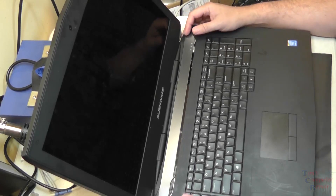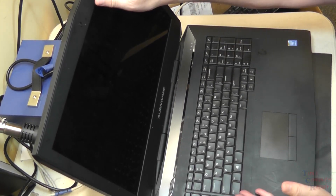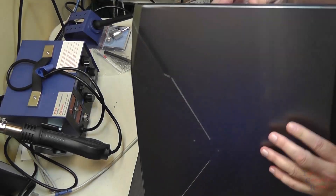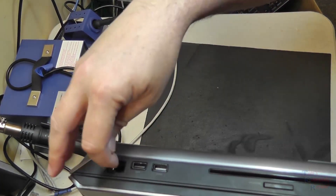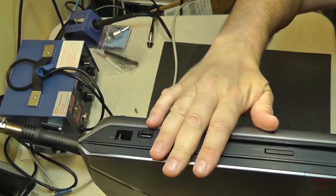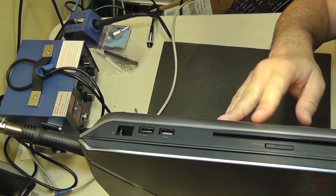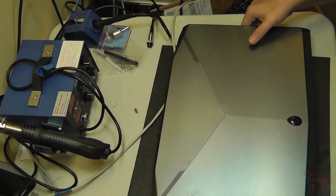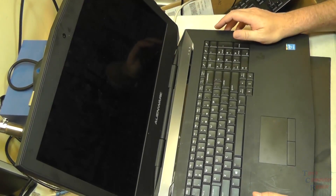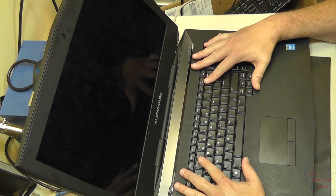There's no Aurora, there's no M18 or whatever — this is a straight-up Alienware 18 made by Dell. The issue with this is they're having network problems, specifically wireless. One obvious thing about this computer is that the Ethernet port has been broken off and pushed in. I'm trying to determine if the whole network interface on the motherboard is shot, or whether it's just the wireless network card. Going into Linux, it did not see the wireless card. Windows does see the wireless card, however it doesn't activate — it doesn't show any networks; it says it is turned off.